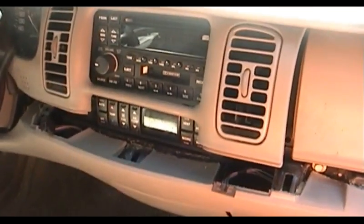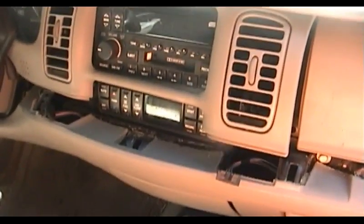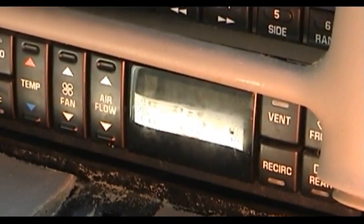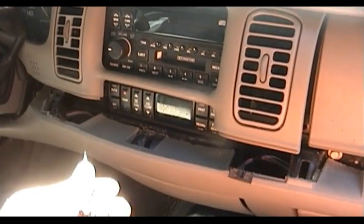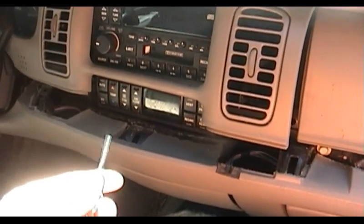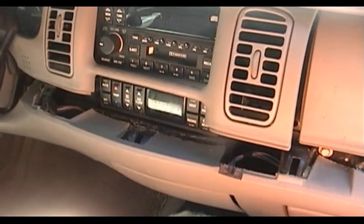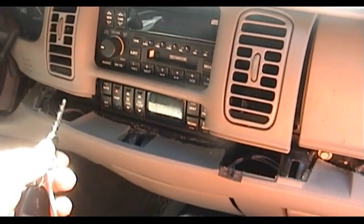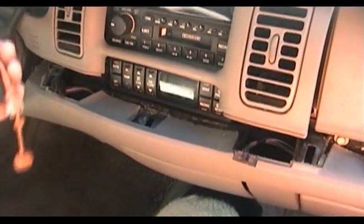This is a very common problem with these cars. I was clued into this issue and its cause by fellow YouTube user Moldy Mac. He mentions that bad solder joints are oftentimes the cause of a blank or nearly blank or unevenly bright display on these cars. Now they certainly aren't the only possibility. You could have a vacuum fluorescent display that's defective or something along those lines. And of course vacuum fluorescent displays, being basically a glorified light bulb, also do burn out. But that should take a very, very long time before it happens.